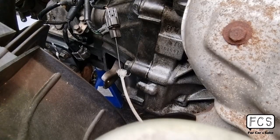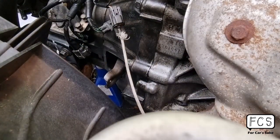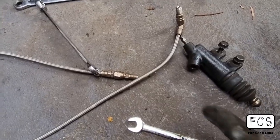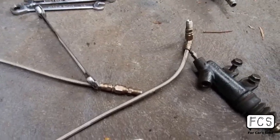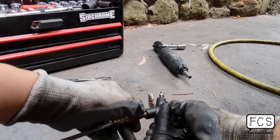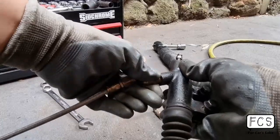The next thing we're going to install is the clutch slave cylinder, and this goes right there. Before we do that, just like we did with the clutch fork, I'm just going to apply some all-purpose grease into the fork. I'm also installing a braided line instead of the OEM fitting with the soft and then hard line. I reckon this is easier to be done out here than it is in the engine bay, because once this is in, you're in a really cramped and tight area.